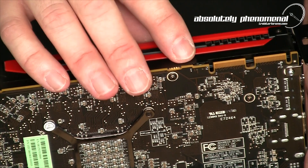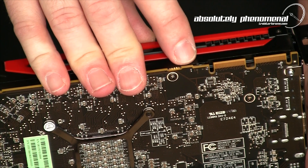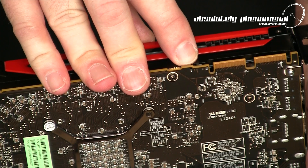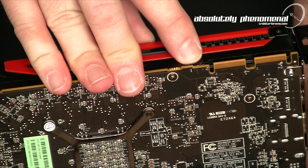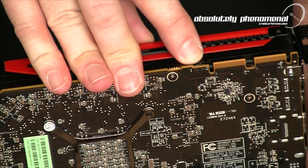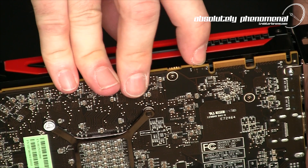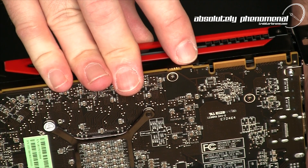Next to your Crossfire Bridge connections you have a great option on this card — the dual BIOS option switch. This switch is shipped from the factory in position number 1, which locks you into the factory default BIOS and while in this position is non-flashable. However, flick the switch to position number 2, which unlocks a high performance BIOS on the graphics card and enables you the ability to flash this card with alternate BIOSes. Just remember though, if you do have a bad flash on this card and it goes disastrously wrong, simply flick the switch back to position number 1, reboot your PC, and your card will be back up and running.